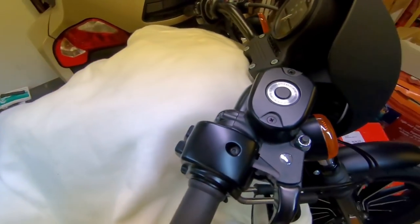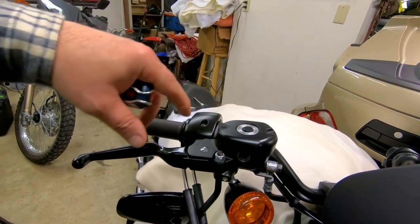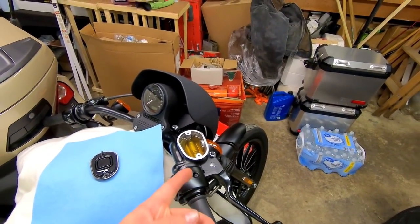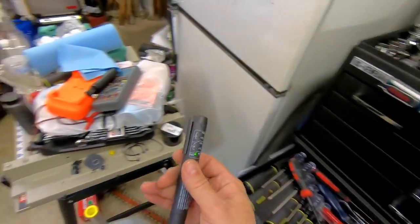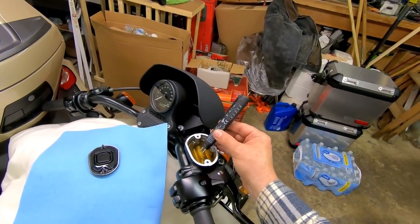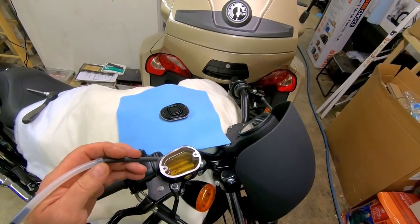That's where a laser comes in really handy, because you want the master cylinder to be as level as possible. If not, it's going to tilt to one side. When you try to put the cap back on, it's hard to get the oil level to the correct height, and when you put the cap back on the diaphragm in there it's going to push the fluid out all over your bike and make a huge mess. You guys remember what percent that thing was last time we were in there? Two percent — right on the verge of going too far. Make sure you clean these things off. Number one: never point the exhaust of one of these vacuum tools at anything, because sometimes they can mist brake fluid out — and misted brake fluid all over your motorcycle equals not a good thing.